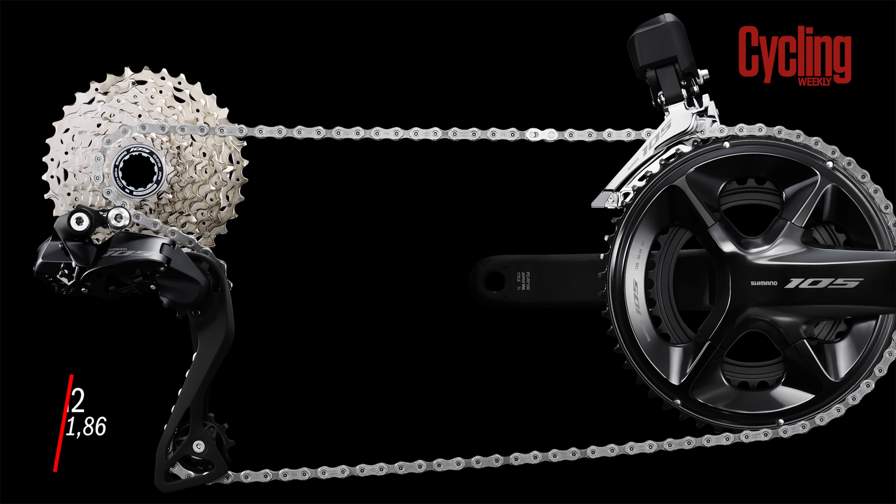There are pros and cons of both options with no clear winner — it really depends on personal preferences. SRAM's is easier to build: you can just bolt the derailleurs straight onto the bike. With Shimano, the battery inside the frame lasts longer and you get more range on a single charge, but you can't take the battery out to charge separately and you do have to connect the derailleurs to that one central battery.